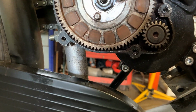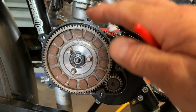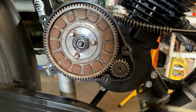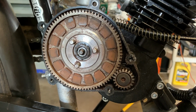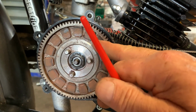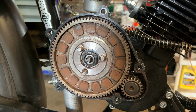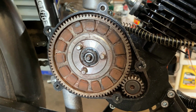That way when the engine gets warm, we don't have a bunch of excess grease flopping around in here, sticking in our case, because when the engine gets warm, it turns a little more to liquid, and it can run down, drip, whatever the case may be, get on your pads, and now you have to replace the pads, because after they soak up oil, they're pretty much just toast.